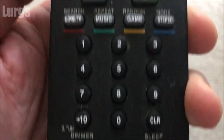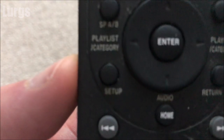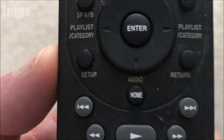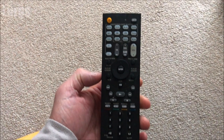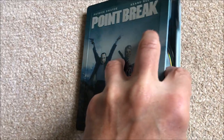The other thing that you can try if you've still got lip-sync problems: you might have a setup or a settings button on your actual surround sound amp, and what you can do is you can actually delay the sound processing going through the amp to try and match it up with the picture on the TV. You can adjust the sound by milliseconds up or down, but really you shouldn't have to start mucking about with that, and now I've got my system all sorted.